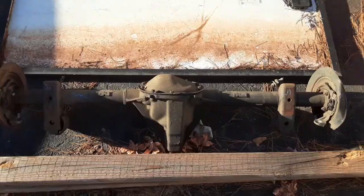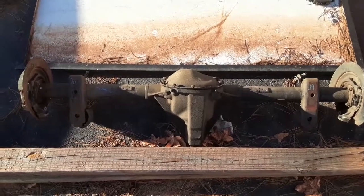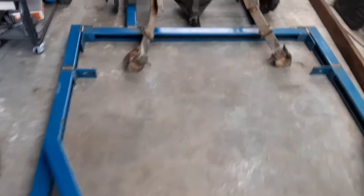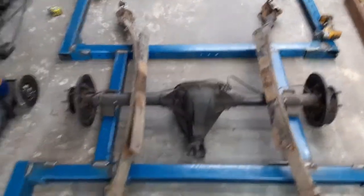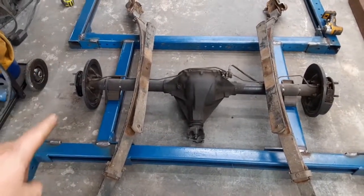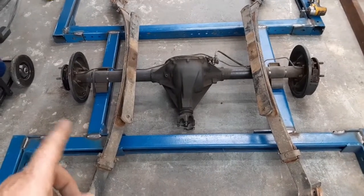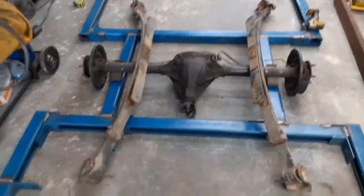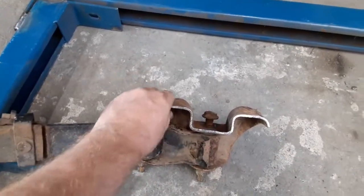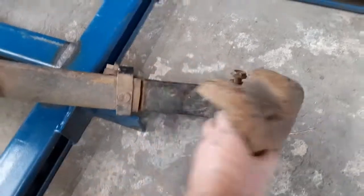For the axle of the trailer, I'm just using an old 7.5-inch from an S10 — I've got a couple laying around from an 8.8 swap, so cheap and easy. I've got the frame all welded up. The downside of using a car or truck axle is the width — you won't get a full axle width, but it's free and for this application it's fine. I got some leaf springs off a Silverado at the junkyard, super cheap at about $25 each, along with the frame mounts cut off with a Sawzall and the rear shackle. So I've got the whole OEM-type setup — just weld the brackets on and I'm basically done.